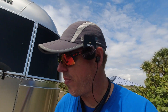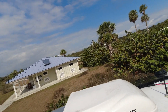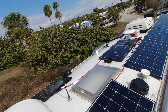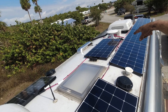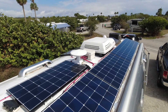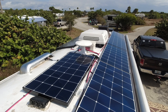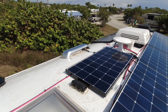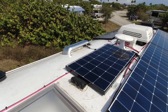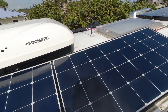That comes in and goes to the MPPT. We were able to get 10 panels on the roof — I'll go up and give you a look. We have six down this side, seven is in the middle, eight, nine, and ten up in the front. There is the combiner box where everything connects in, and coming out of the left side of the combiner box is the large wiring that goes down, comes across and goes down into the refrigerator vent and then goes down inside, which I've already shown you that side of it.